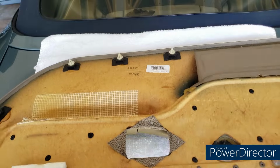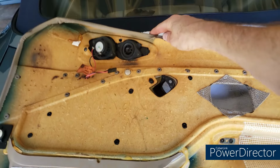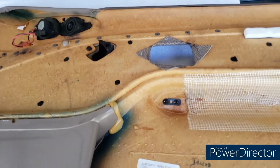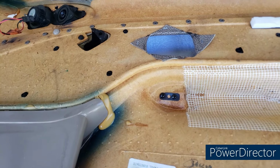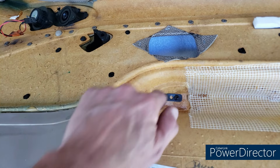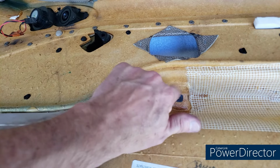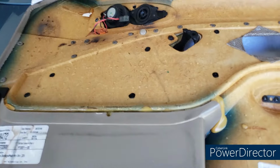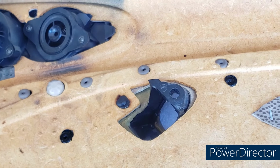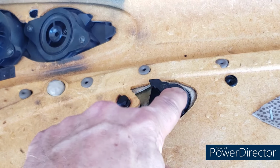Anyways, this door handle is held in, again, not very well. It's held in at the aft portion of it by these 2 little screws and this metal bracket. And that seems to work. And again, around the fiberboard part of the door panel, the main part, it's this guy up here, which tends to be everyone's problem, it seems, where that T25 torx screw I took out at the beginning of this came out of.